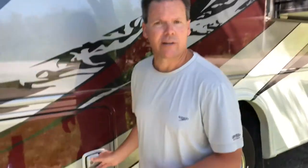It's the exact same thing as a house. If I were going to be dumping and being done with using all of our water and sewer — the gray and the black — I would drain my black first and then I would drain the gray. We are going to be using our toilets and things on the way home still, so we'll still do a full dump at home. For right now, we're just doing a quick one — leaving the black, just going to do the gray — but we'll show you how to do that quickly.